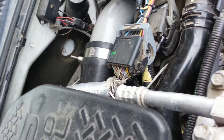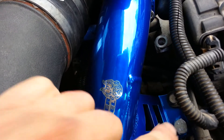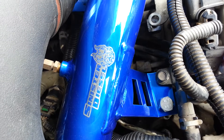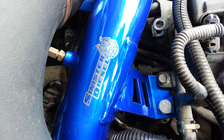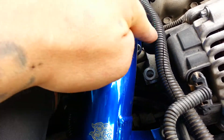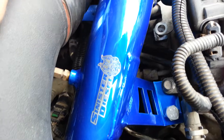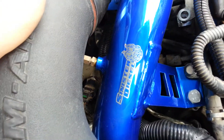It is hard to install. These two bolts right here don't line up right — I don't know why, but I've read some other posts and they're the same way. You have to grind it out a little bit to get it to work, but it will. Don't tighten up anything — install these first, don't tighten them up, then install these two. Once everything is going and you're not cross-threading anything, then you can tighten everything down and put everything back together.